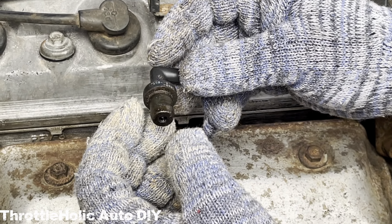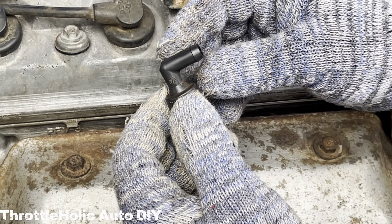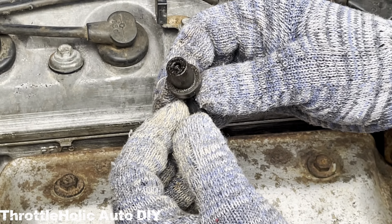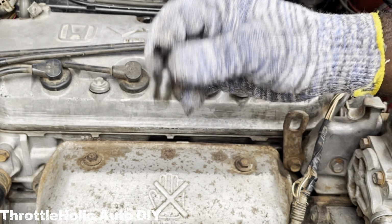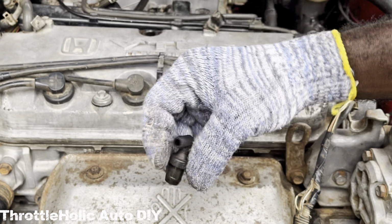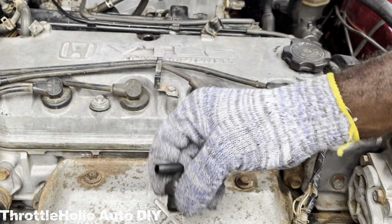Generally, there is no specified replacement time frame or mileage for the PCV valve on this generation of Honda Accord. You simply replace it when it goes bad. To figure out if it's replacement time, simply shake the unit after it comes out. It should rattle, indicating it's still working fine. If it does not, it's time for a service or complete replacement.